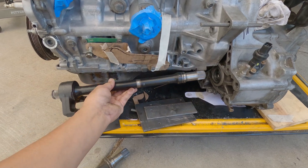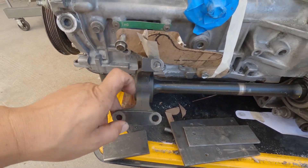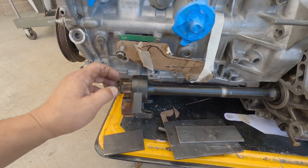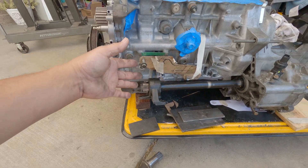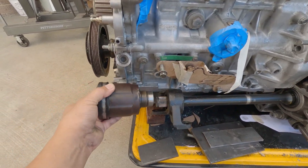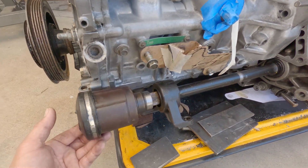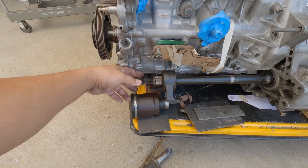This is the H22 - or Honda Accord - and it will work fine. Look at where it lands - it's almost right on there, just off a little bit. You can see right there that the only problem is it's lower. I was thinking about doing something on this one. Like I said, it's a custom H2B or G2B build. By using the H22 there is no need to modify much - if there is anything that needs to be ground or shaved, it's only minimal. That's how much space I have - very, very minimal. I want to save the block as much as I can.